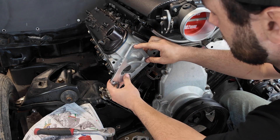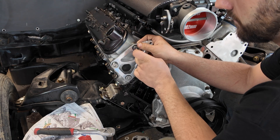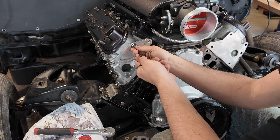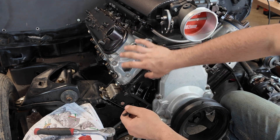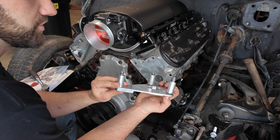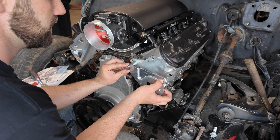After fixing the binding issue with a little Blaster Multimax, I went back to mounting the alternator bracket and the bolts ran in as smooth as ever. These threads are so much smoother now. Alternator is going to sit here. Get your spacers in there and you're ready to put the power steering bracket on.